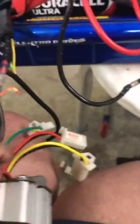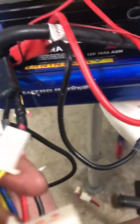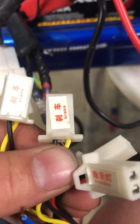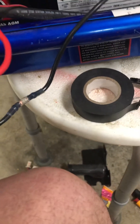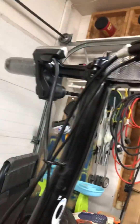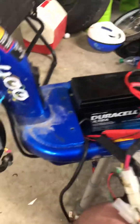This one says brake light, and over here this one is the key lock. Typically on a machine you'd have a front and rear brake — it's just this wire right here. What it does is prevent a kid from twisting the throttle and the brake at the same time. If you hit the brake, it will shut off the controller — it's a safety device.